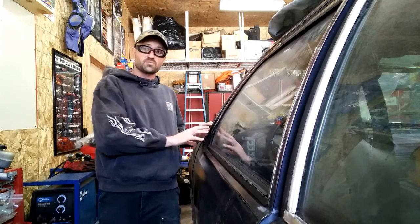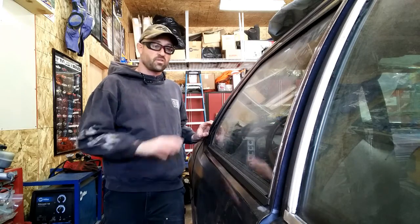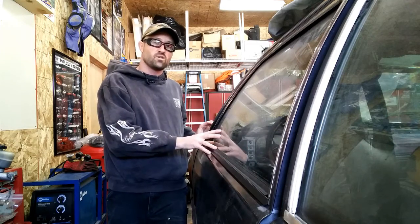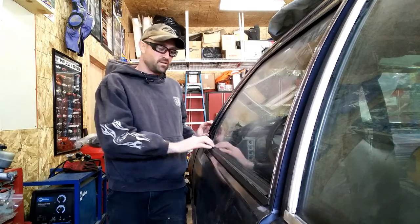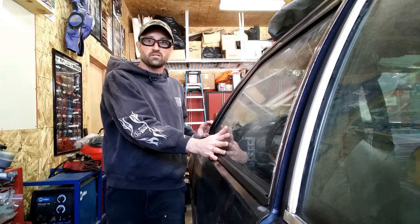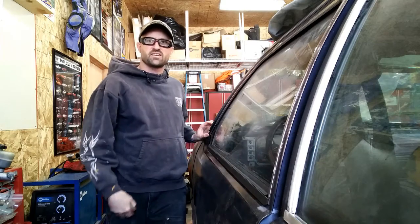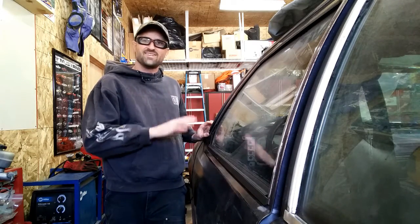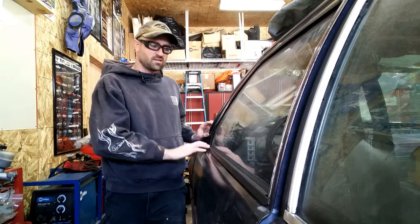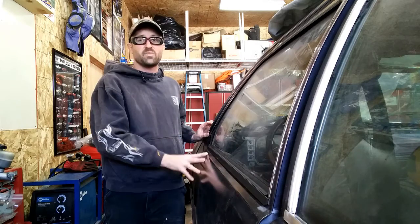Once that's all on, all you have to do is put your mirror back on, your mirror cover, everything else, and you're ready to go. Whether it's chrome or black, your rubber should fit nice — you'll probably notice a little more tension on the window than with the old crumbly seals. This is going to wipe down moisture on days with a lot of condensation. Give it time to break in — fresh rubber takes a couple months to heat cycle in and adjust. These are good for another 30 years probably, so hopefully I don't have to change it again, but they're really not that bad to do.